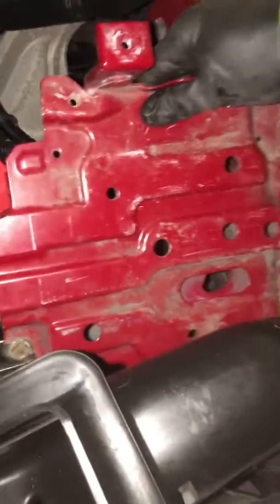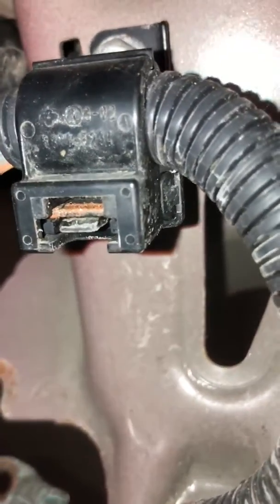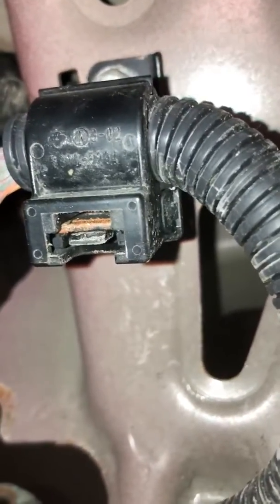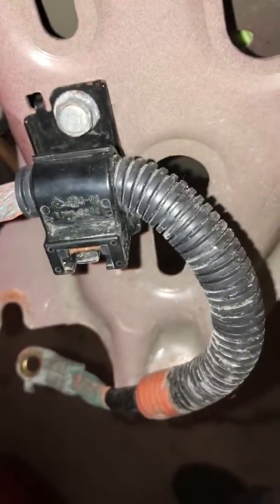Maybe slide it in a little better. So the battery tray, these were your bolts here, and there. Probably not the best pictures, kind of roughhouse, but I wanted to show you. So this is the grounding harness. You can see there's a harness there. Probably easier than removing that bolt is to take those 2 bolts out that I had previously showed you to take the grounding wire out. Or there's a clip right there, so you can back that clip off. I didn't realize that it was a clip like that I could just take off and leave those grounding wires in. But that's on the back side of the battery tray.